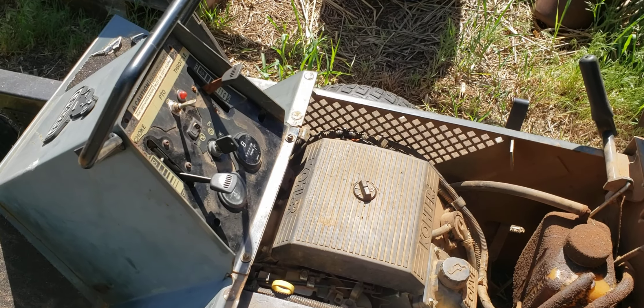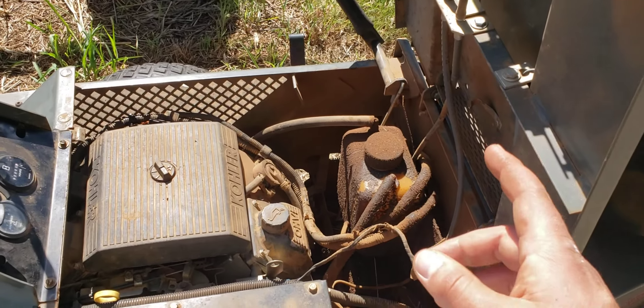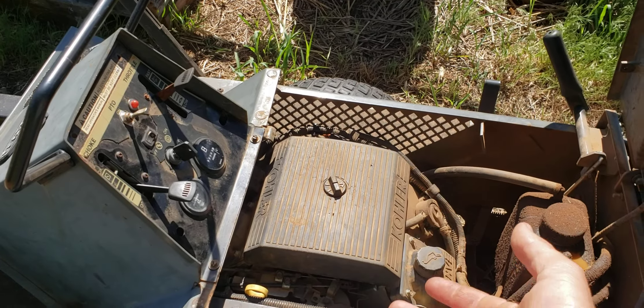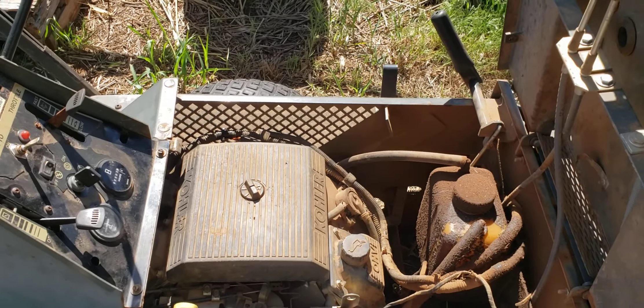It's been started several times since then, so I'm going to say I got the electrical straightened out — all because of a ground wire I probably should have been looking at. The bad ground caused the cables to melt, then it wasn't charging right, the hour meter wasn't working, and now the mower starts and works great.